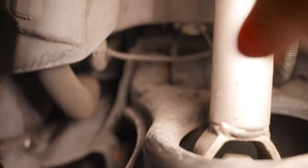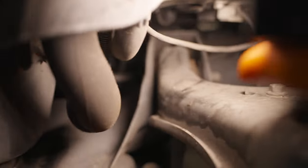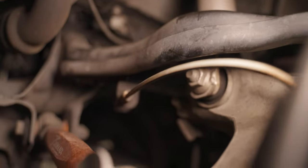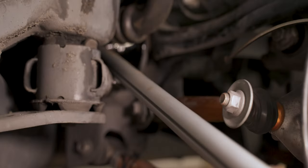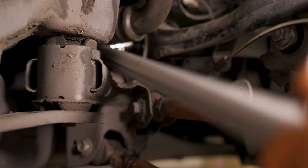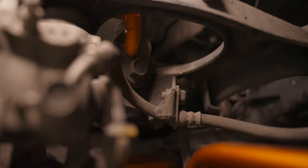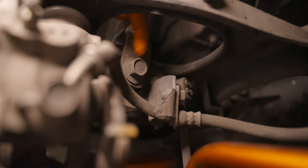So now we're going to take out the upper control arms. Unbolt that bolt behind there and that other one in the back. I need to take out the bolt on the bottom of the strut there. I'm using a breaker bar, but it's very tight in there. So now I just got to remove the bottom bolt from the strut.